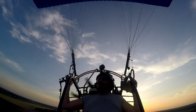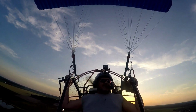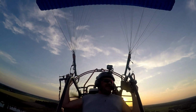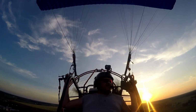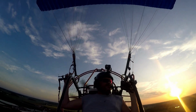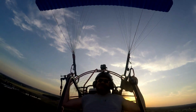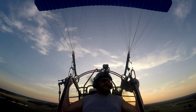Oh my gosh, man, I've got like 50 things going on right now. All right, get back into flying. I got rid of the 160 jet, decided to put in the 155 jet. I seem to be getting a little bit more RPM. My climb rate seems to be a lot higher. Altitude 256. Got a couple bumps up here, nothing super bad.